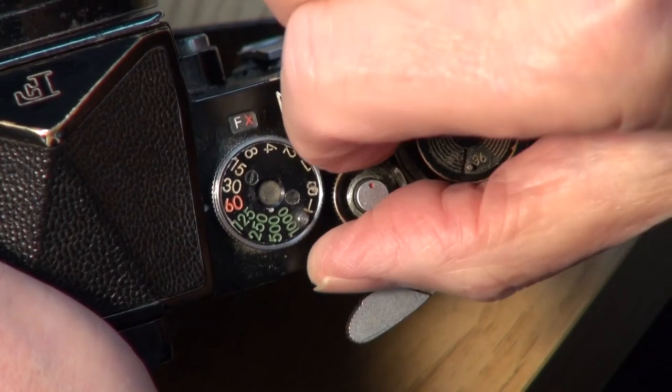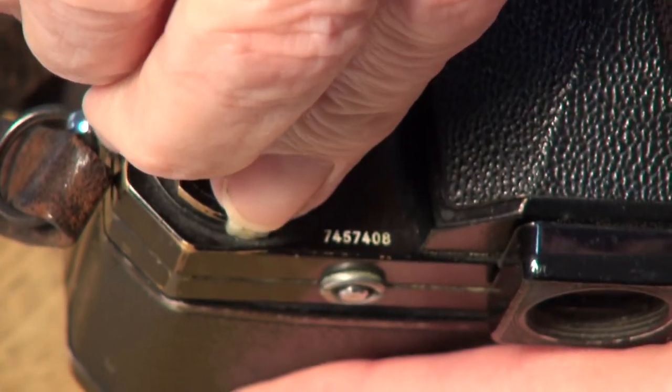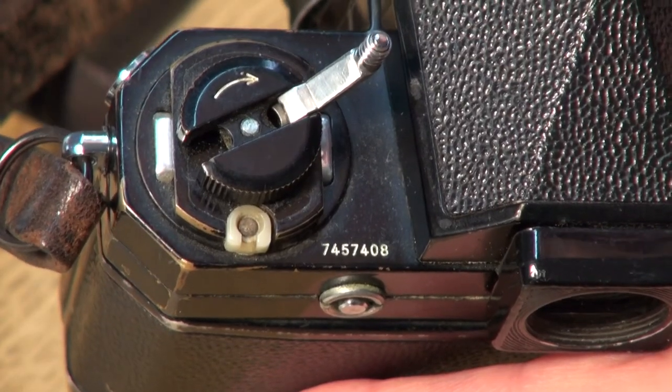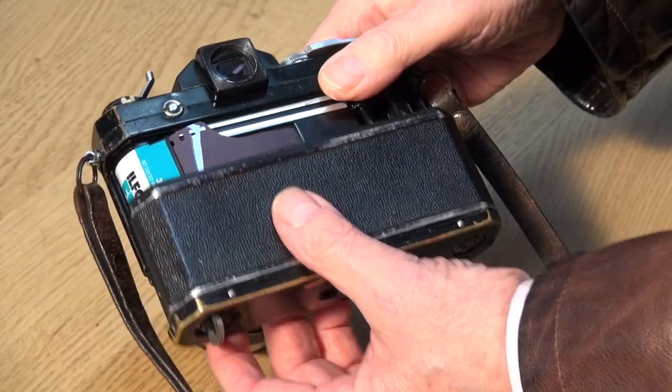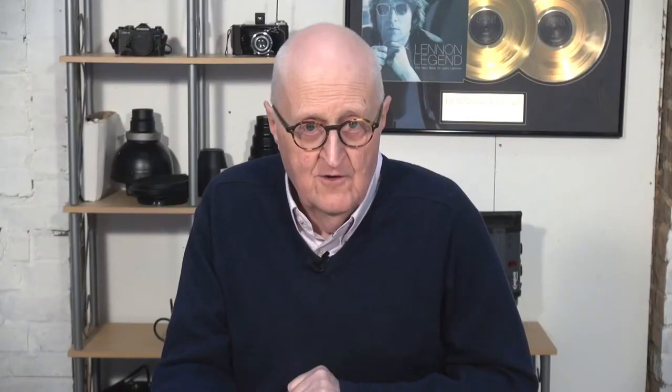When you come to take the film out of your camera, the mechanism will be slightly different on each type of camera so please refer to your specific camera's user manual. Here's how you do it on my old school Nikon F: turn the A-and-R ring button to R for rewind, then lift up and turn the film rewind crank handle. You should feel a slight resistance as the film is being pulled back into the cassette. At a certain point you should hear a faint click as the tongue of film gets released from the spool. When you're happy that you've rewound the film, turn the lock the opposite way, open the back of the camera, and take out the film cassette. You're now ready to head to your darkroom or hand the film to your processing lab to have your photos developed.